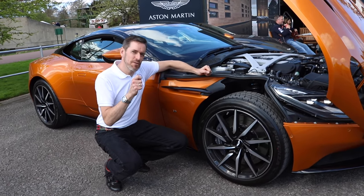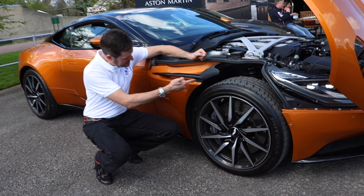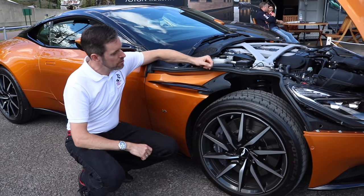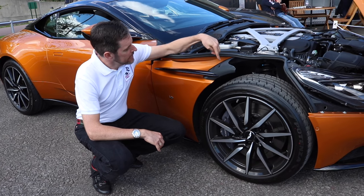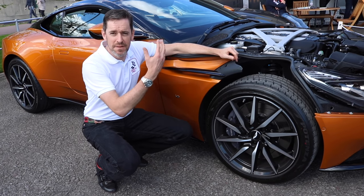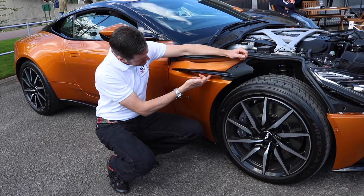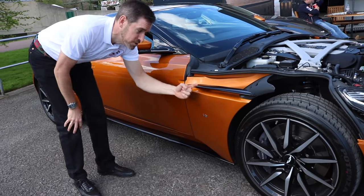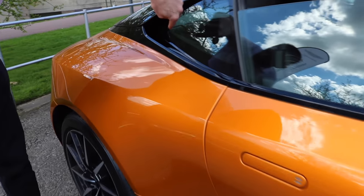Let's have a look at some of the tech on the car. The standout design feature for the DB11 is this strake in the front wing, and it's got a functional job, not just an aesthetic one. At high speed you get a high pressure build-up in the front wheel arch, and these vanes allow that pressure to be released — a bit like the GT3 RS has on top of the wing. In the DB11, the airflow comes out of here, and underneath there are little bumps called curlicues that create a vortex.